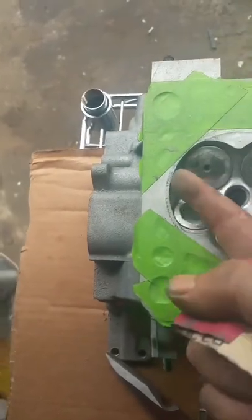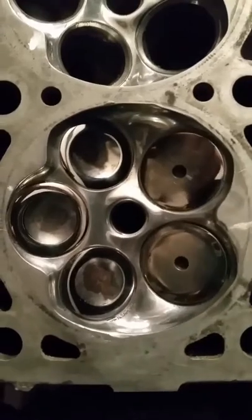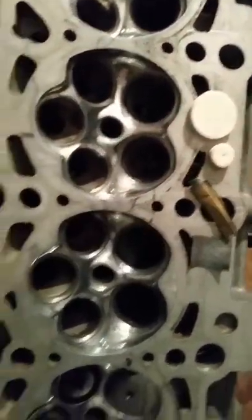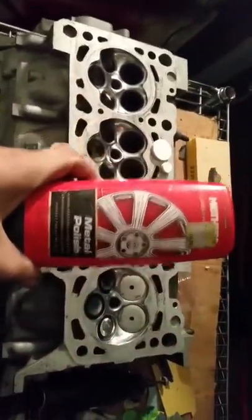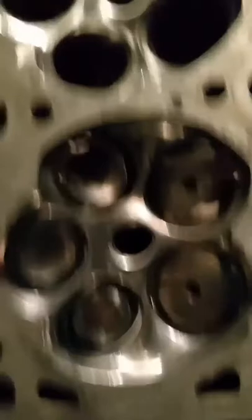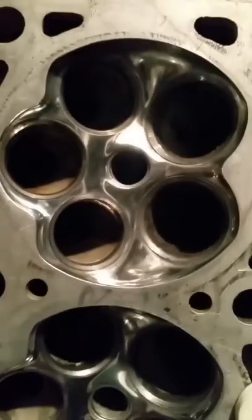It's just patience, and I know none of you really want to see another five to ten hours of sanding, so I'll go right to the afters. There's the shine — I hand-sanded with little rolls and little squares, and once I got up past 3000 I switched over to the Dremel with the polishing bits and used some Mother's metal polish. I used 220, 320, 400, 600, all the way up to 3000, and then finalized it with the Dremel going around all the little nooks and crannies. As you can tell, it came out great — all four.